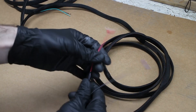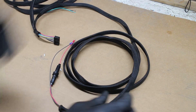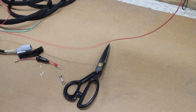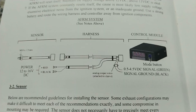Now it's time for the wiring. These two wires are the ground and the main power for the wideband system. The sleeving was huge, so I removed it and shortened up the wires. The two long wires are main power and ground. The two short wires are the 5V signal wire and signal wire ground. The signal wire is used for things like data logging.